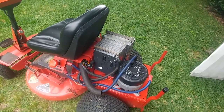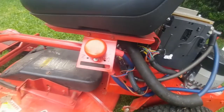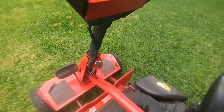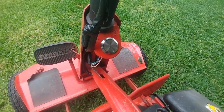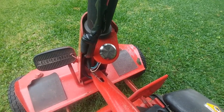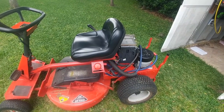To get energy to the motor safely — instead of just taking two giant wires and touching them together, which is obviously dangerous — you use a contactor. The contactor sits down underneath here. I have a big red emergency button in case I crash into a tree or my son puts it in the pool. There's a power button down where the ignition switch used to be. What it does is close the leads on the contactor coil — it's a small switch that closes a big switch — and the big switch lets the 48 volts go from the lithium-ion battery to the motor.